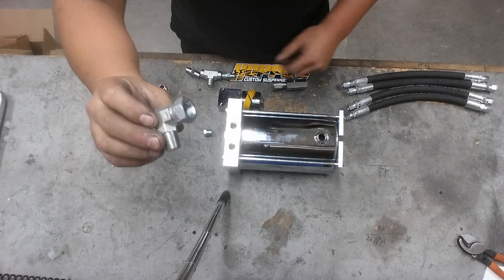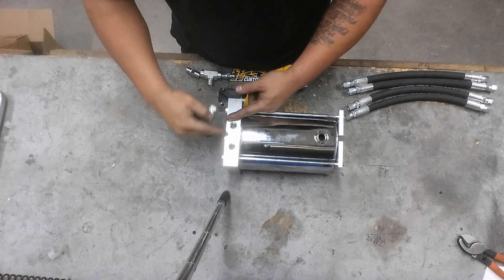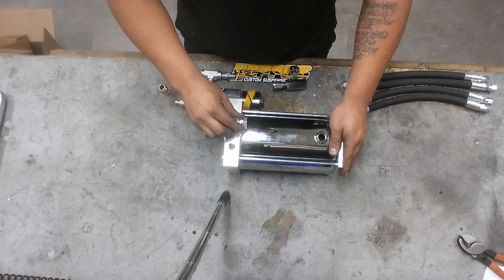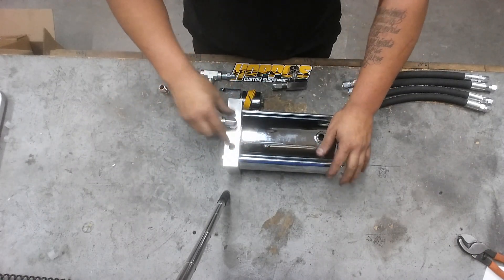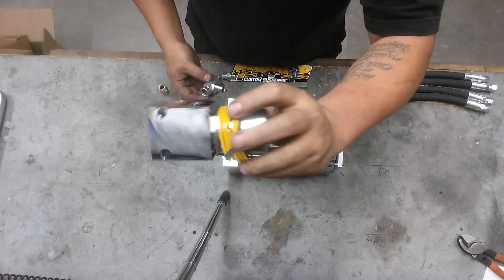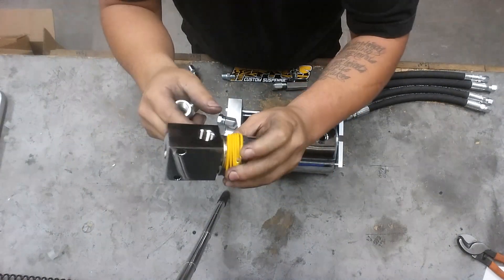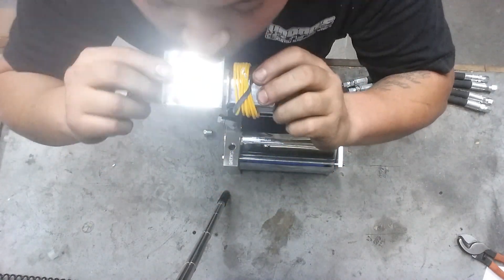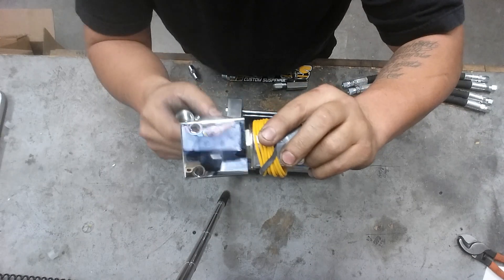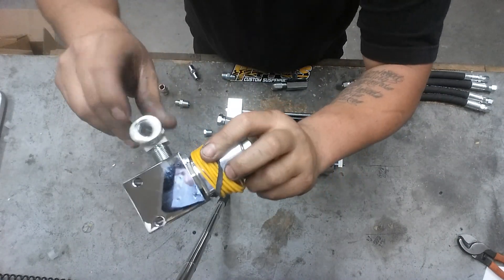The swivel is going to go into your pressure port — more towards the center. So you're going to put this on. Make sure you guys are tightening it up 100%. Your dump — this is a basic delta dump — and this T is going to go into one of the free flow sections. The reason I say free flow: if you blow through this, air travels directly through. If you plug one side, air is trapped. This chamber only opens when you trigger your dump. So put your T on.